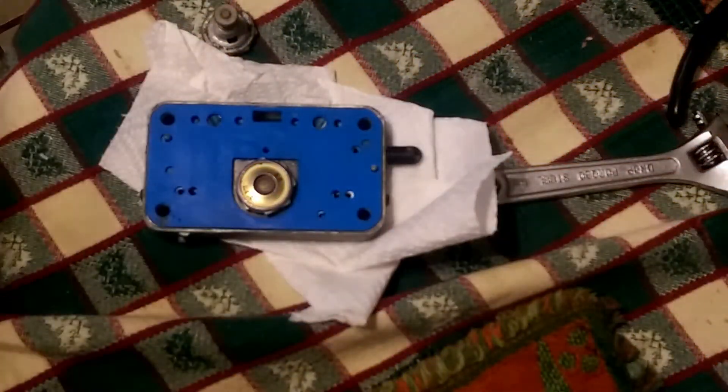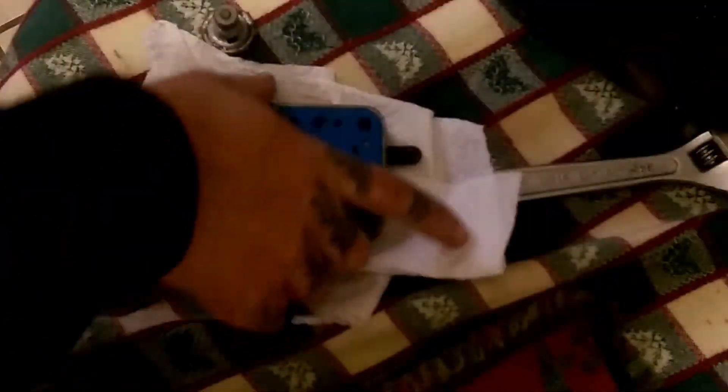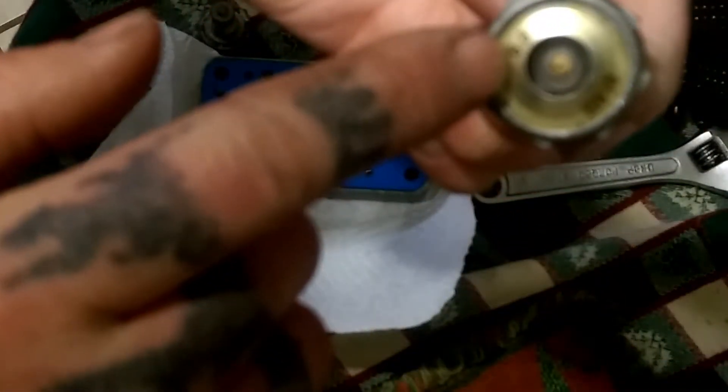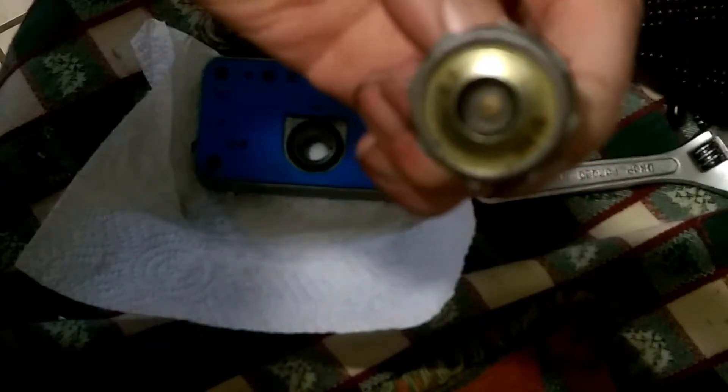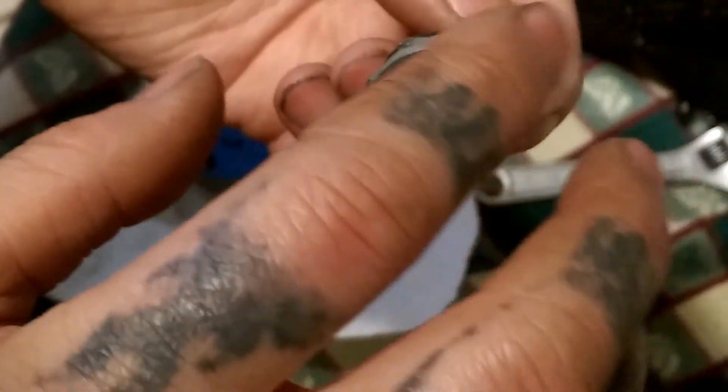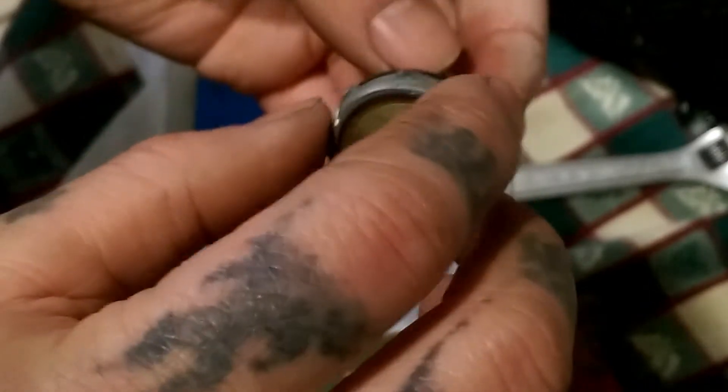It's cold outside so I came on inside to do this part. Here's the old power valve — you can unscrew it. You can do a vacuum test on it if you want to. Our gasket looks good. This is a 6.5 — you can see right here, 6.5. That goes on your vacuum rating. If you've got say 12 inches of vacuum, divide by 2 and you can come up with what power valve you need.